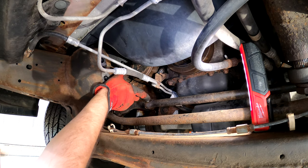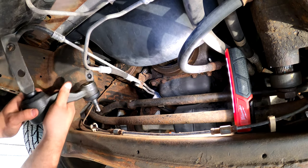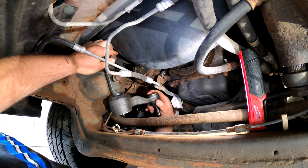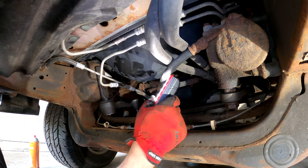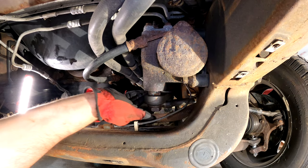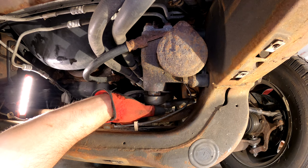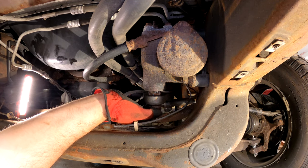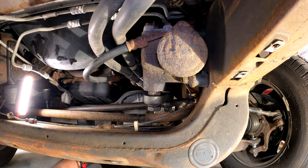Two 21mm bolts go through the center link — we'll be able to tighten everything up, torque everything down, and put the pins back in. Brand new Moog idler arm — slide that through the end link. Don't put it through the center link just yet; get these two bolts lined up and started. Mostly got everything back in place. The idler arm just needs to get attached to the center link. I'm having some trouble getting the center link to line up, so I'm thinking if I get this side all back together, then we can adjust it by moving the steering. I'm going to get a little red Loctite and work on pressing this pitman back on with our wrench.